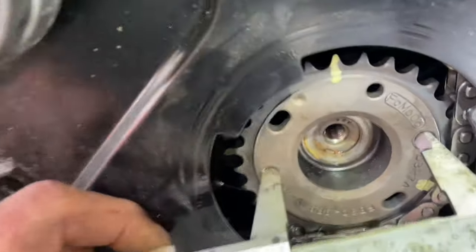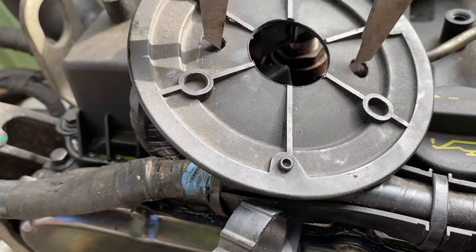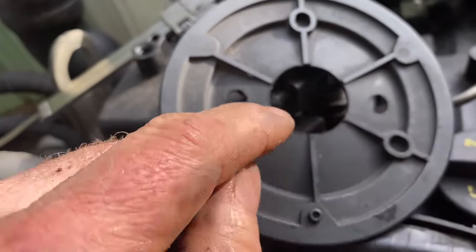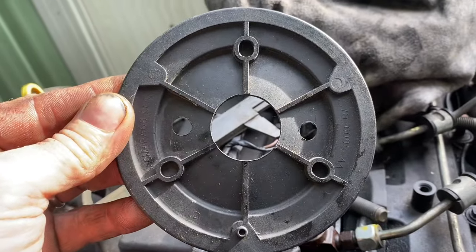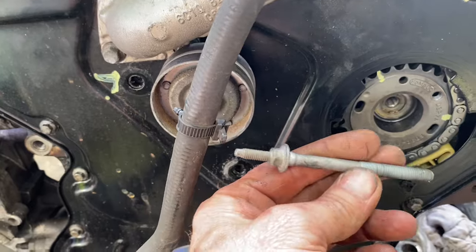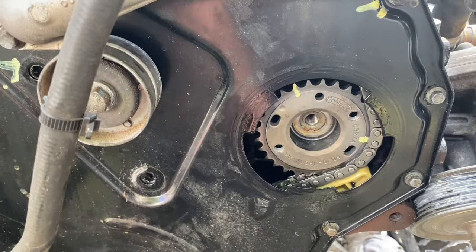What I'm after doing is I have that actual cover that sits on top of the pump pulley in the actual timing cover. I can see it's threaded into two threaded holes here. What I've done is I sat a vernier in to get the width of the holes. Then on this cover that I've removed, I've actually drilled two holes in relatively equal spots on each side of it, and then drilled a hole in the actual middle of the cover.